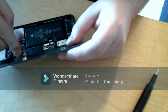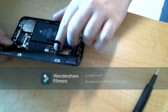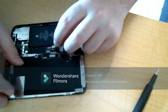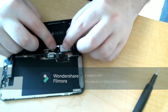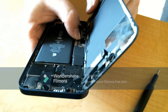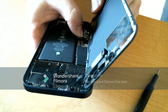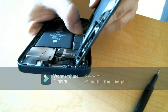Now just go ahead and put the flexes back on where they went — your new screen will look exactly the same as your old one. You still don't want to reconnect the battery yet; that's the first thing we disconnected, so it'll be the last thing you connect. Get the flexes on — they can be a little tricky — but make sure they're lined up and you should get a nice little click when they finally connect.